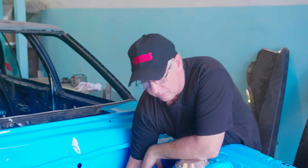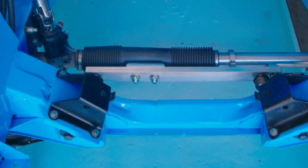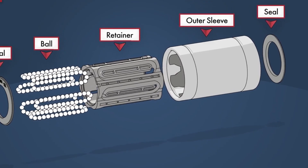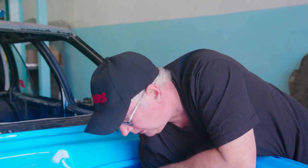The other unique feature of any RRS rack is this linear tracking device here — it's the thing that sets our rack apart more than anything else. It provides a third stabilizing link for the load generated on this drag bar. Without this slider there would be excessive load on the centre slider. This unique bearing has a recirculating ball system mounted on a hard chrome shaft, so it's weather resistant — the type of bearing you'd find in a machine shop, in a lathe assembly, CNC, that type of thing. It provides a third stabilizing link so that this bar is firmly supported.